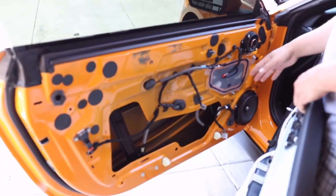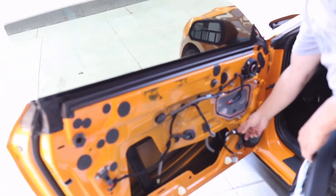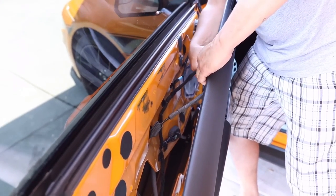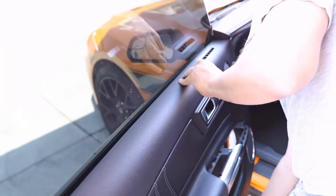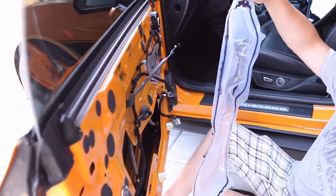I'm going to go ahead and put everything back together. It's dry enough down here and I've cleaned up the excess sealant. I got the speaker tight and went ahead and put a zip tie on this harness. Your harnesses are going to be a little different than mine. I'm just going to pull some of the slack out and bend it around into that loop, go in from the bottom, push it up into that hole, and it drops into place. Then this harness clips into place. Make sure you feed the harness through so you can get your window mechanism working. Then I'll put it on the hooks — rest the door on top and it goes straight down and catches on the hook — then line up the plastic to make sure everything pops into place.